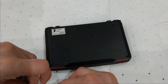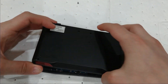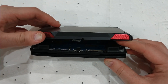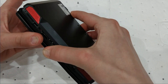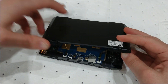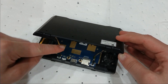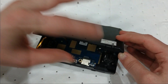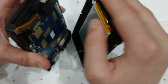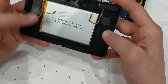One screw was stripped so I had to do some work. Now carefully peel this back. You can see we have the battery and the two shoulder ribbon cables — we gotta be careful not to tear those. Obviously before you do this make sure it's shut off. Let's disconnect the shoulder cables here and here; they simply flip up and pull out. And now let's disconnect the battery.